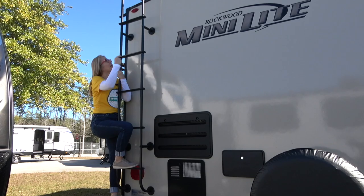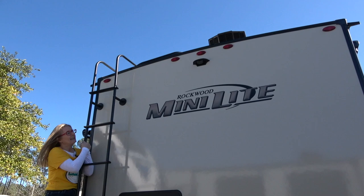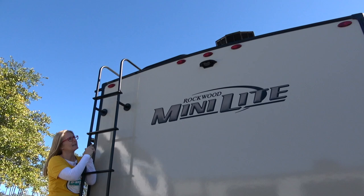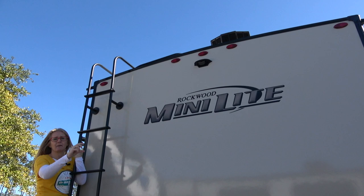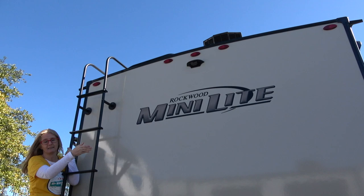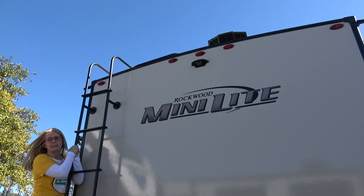The roof of the Rockwood is also a vacuum bonded laminated roof with an aluminum construction. It is not trussed, but has a full aluminum frame. The block foam insulation in it is about three inches at its thickest part and comes down to about one and a half inches on the edges — that's what gives it its curvedness, which you need for shedding water. On the inside there is luon board, and on the exterior there is a TPO roof. Everything is sealed up and goes into the laminator.